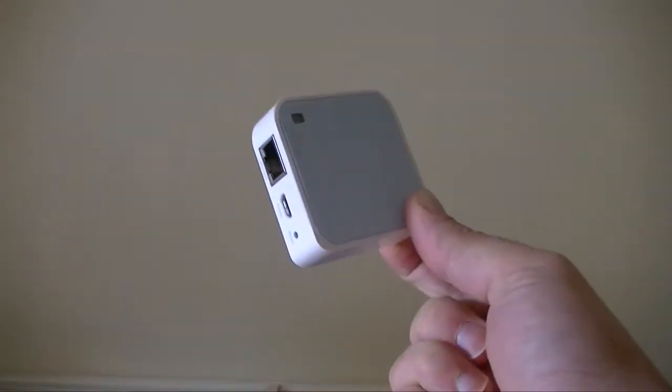We also need a whole bunch of USB cables. I went for the ones bundled with the supply, so these are like 30 centimeter ones. That keeps it all neat and tidy because we are using Wi-Fi for this. We're not using Ethernet cables. We will need Ethernet for one part of this. You will need Ethernet into your network, unless you want to do it manually yourself, set up the Wi-Fi yourself. That's really just to get things configured. You don't need it while it's running. That's just during setup. When it's running, I use a TP-Link travel router. This is bridged onto my main network so that I can basically take the cluster out of the house and take it to places, demo it without having to reconfigure all the networking. And again, this can be powered off the USB hub.